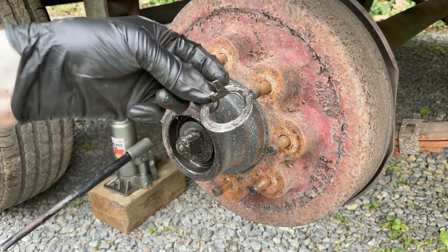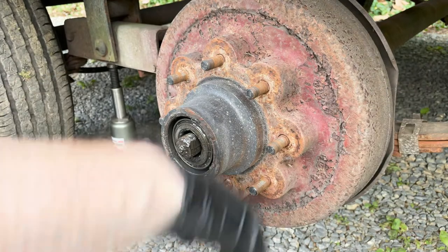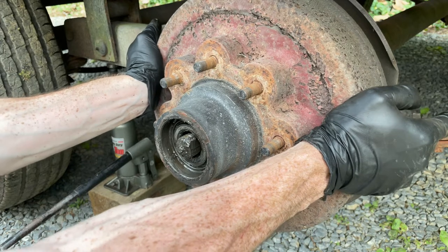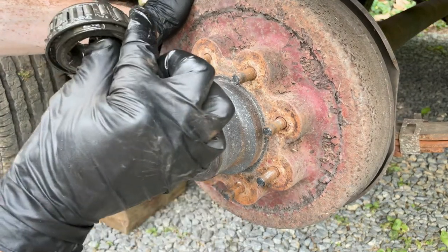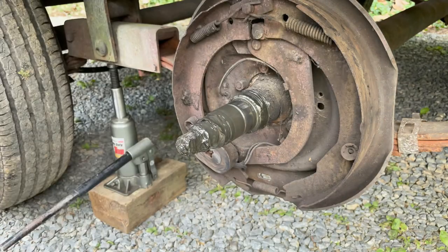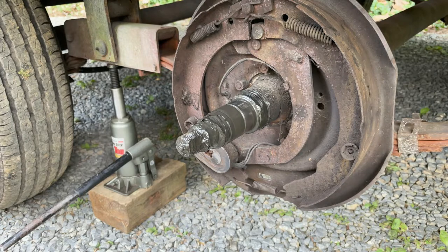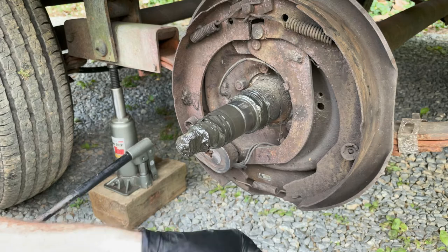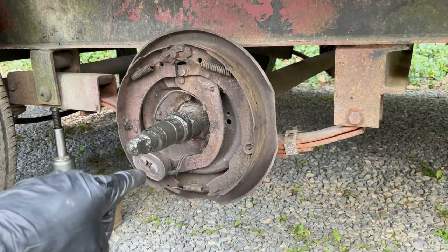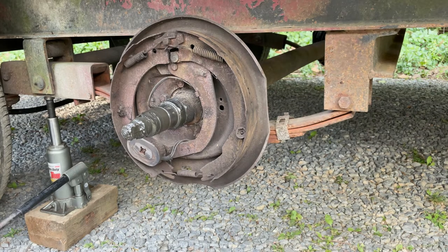That's what this one looks like. Some parts that came out with the drum: what's left of the friction material and the adjuster — I wasn't expecting the adjuster. The next step would be to disconnect the brake wiring harness. I don't have any wires run to this so I don't have to worry about that. Then to remove the backing plate it has five nuts around the spindle, so I have to get those out of the way first.